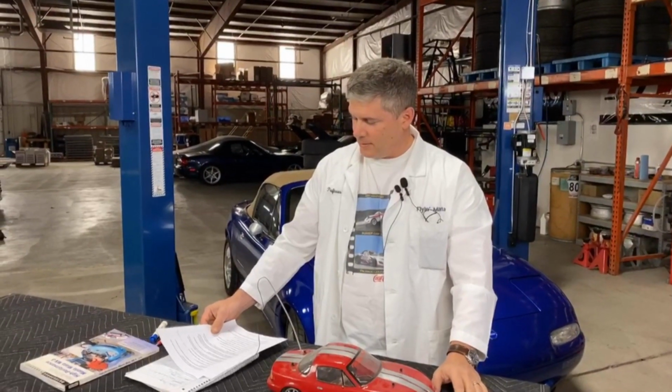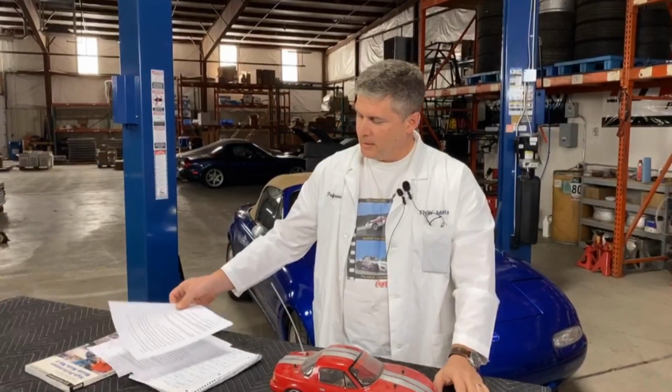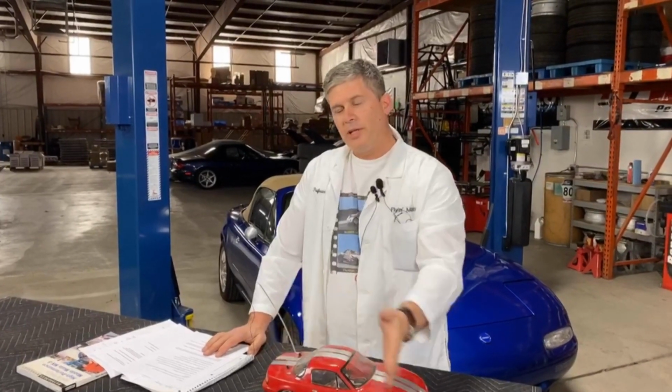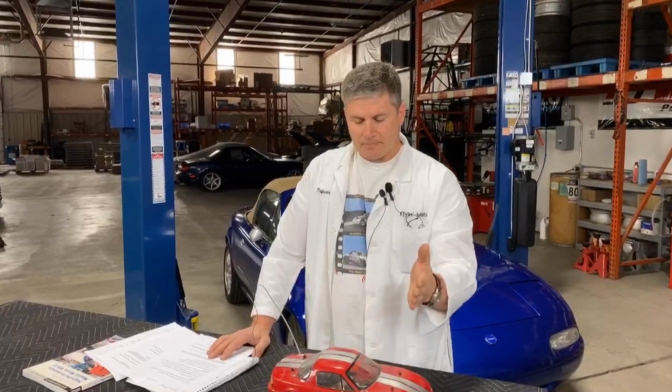Do we have any more questions over there, Kyle? Yeah. Do you recommend mixing and matching brake pads with different friction coefficients and temperature ranges? That's a good question. I will repeat it. Do I recommend mixing different pad compounds front and rear for different friction behavior and different temperature behaviors? I generally try to avoid doing that.